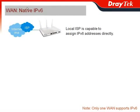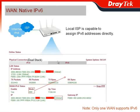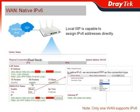The WAN interface of the Vigor2850 series supports two circumstances. One is native IPv6, meaning the local ISP is capable of assigning the IPv6 address directly. When you check the web user interface, you can see the physical connection would be dual stack — it supports both IPv4 and IPv6 networks. When the global link is available, it directly accesses the IPv6 network. In native IPv6 mode, we recommend using PPP as the connection type, as it works for most ISPs.